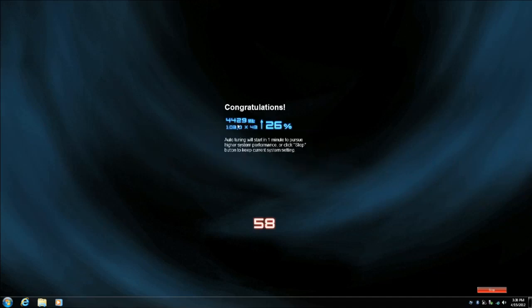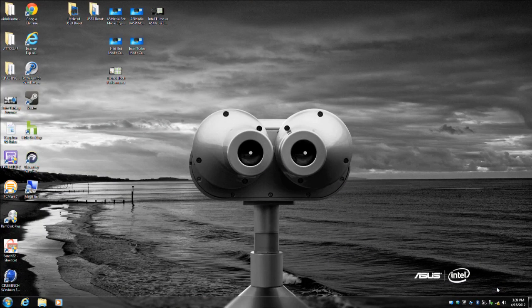We've now reached a new higher value — 4.429 GHz. From here, same as before, there's a countdown timer. If you're comfortable at this point you can stop. Effectively, auto tuning has these breaks built in — it could be as little as a two-minute process, or at the maximum with outstanding CPUs and coolers that can scale higher, maybe up to 10 minutes. That will also be partially affected by your storage device. And it can be completely hands-off — once you click the Extreme button, you can walk away, make a sandwich, let the dog out.